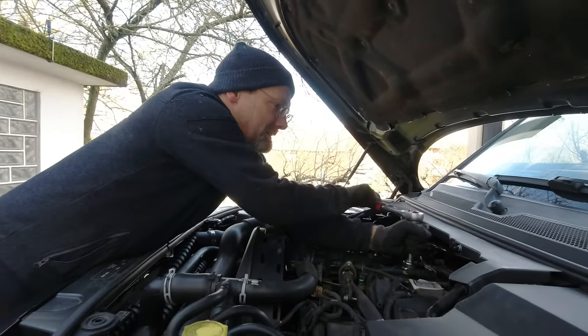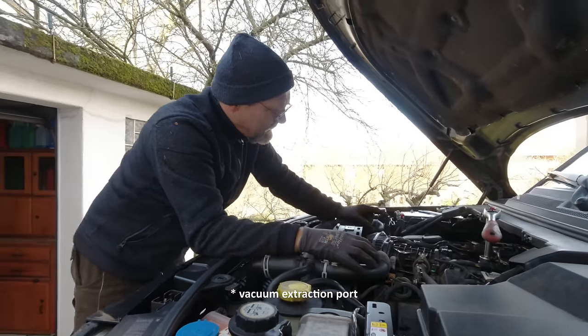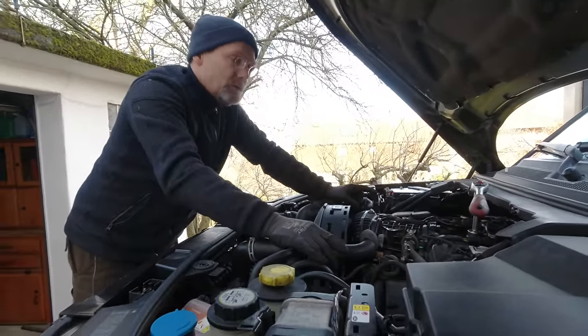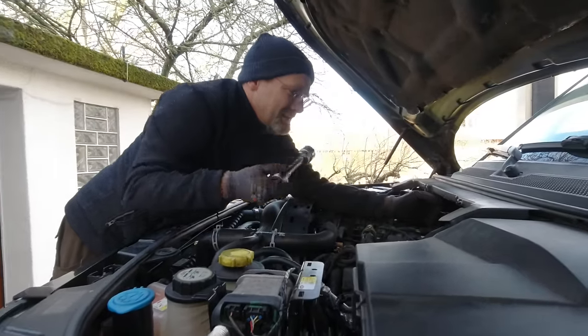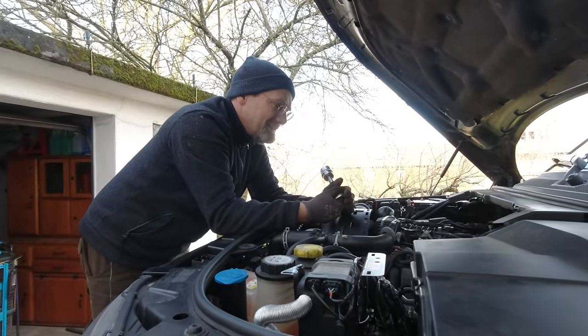Opening the oil filter by two turns so that it drains empty. I'm not using this drain tube — I'm old school. I want to see that oil draining out through a drain plug. By the way, we have already done a timing belt and oil pump replace video on a Discovery 4; for any step-by-step instructions, check that one out.